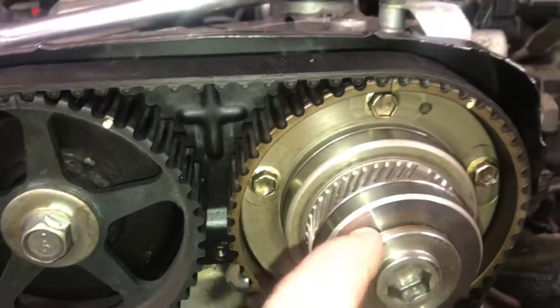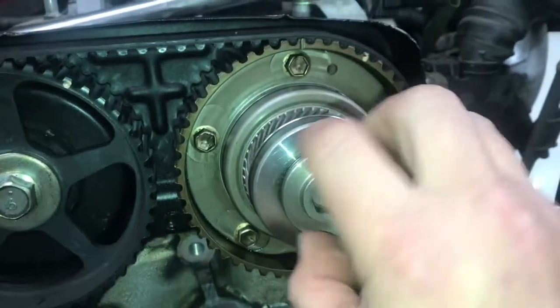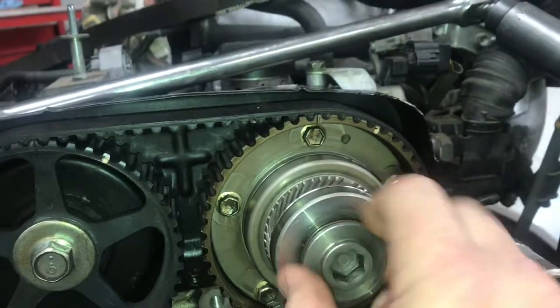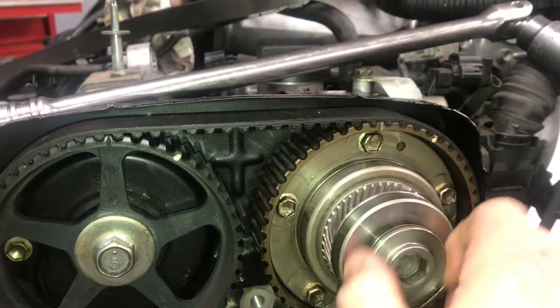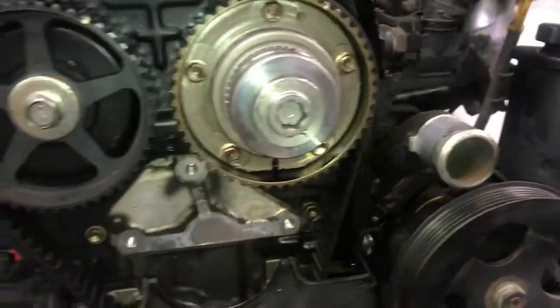Part 2, the oil leak is actually coming from behind here, so you have to take this apart. Actually, I think this cap right here is what the leak is, because this got a bunch of silicone on it, and that's not supposed to have silicone on it. Anyhow, I think that is leaking, but you can take these 5 bolts off here, and there's an O-ring on the inside of there.